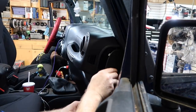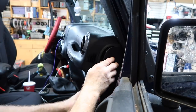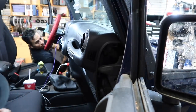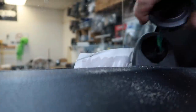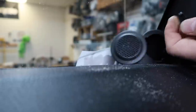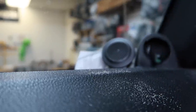We're going to take you through the process of how to put the Rockford tweeter in the factory location. First, pop off the side panel so you can get access to the bottom of the tweeter. Then use a panel tool to work your way around the tweeter until it pops out. Pull it forward — there's a clip on the back with a little tab. The tweeter will come out. Go ahead and tuck that wire all the way down — you're not going to need it.